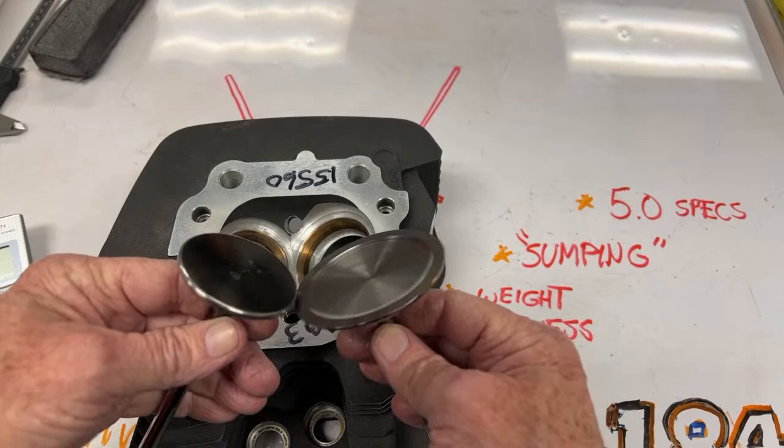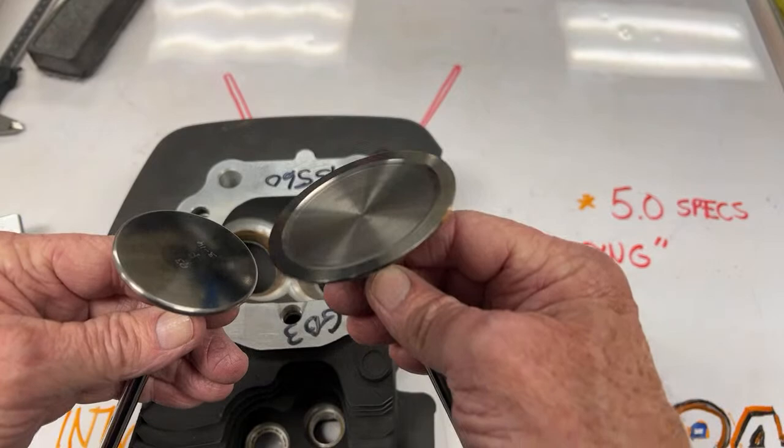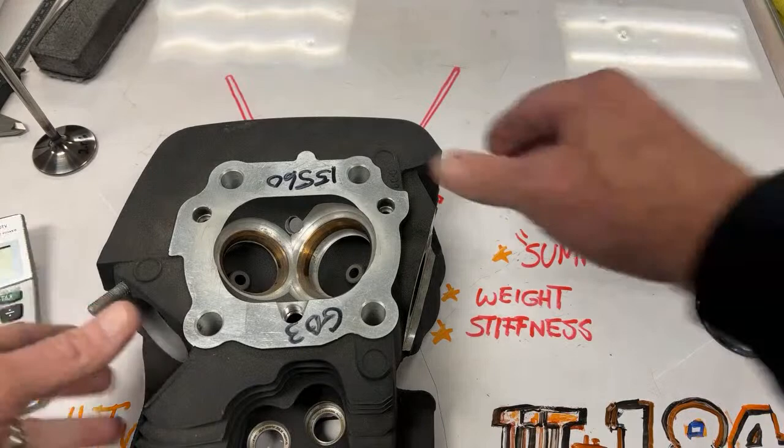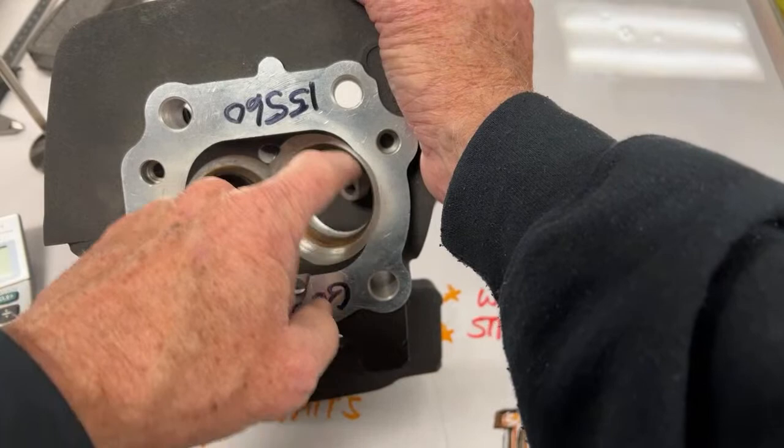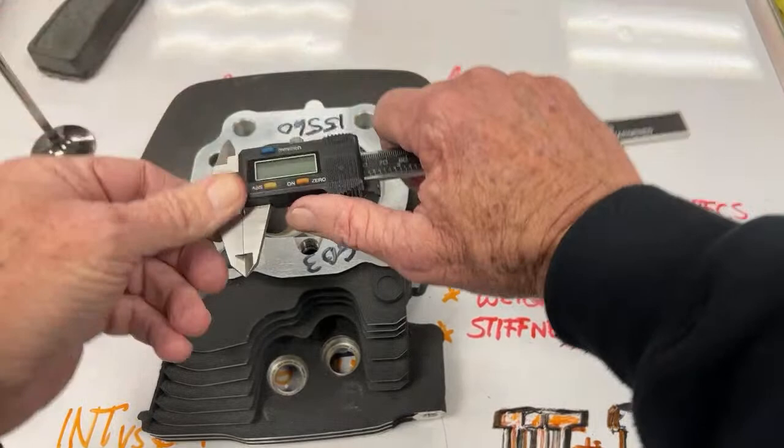And what we did to cure clipping clearance by going bigger on the intake, bigger on the exhaust, is we had to keep sinking and sinking, and we kept filling in with bigger valves. A couple things happen when you do that. One is you run out of room here. Combustion chamber's too tight, the bore's too small. Then we sunk and sunk, but we got bigger than the bore, so I couldn't use this head, y'all. This head got too big from here to here